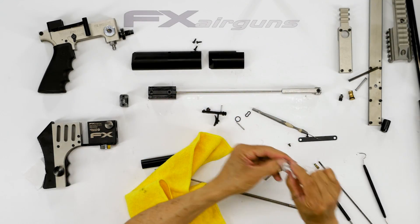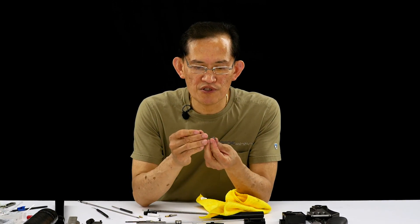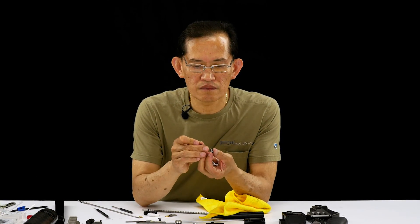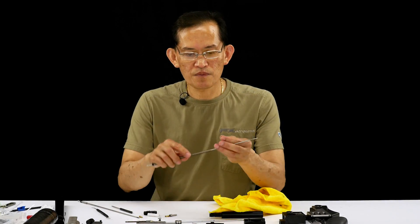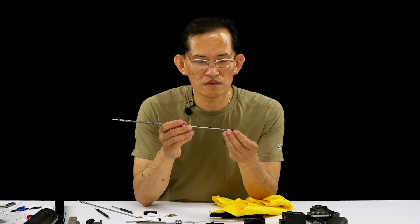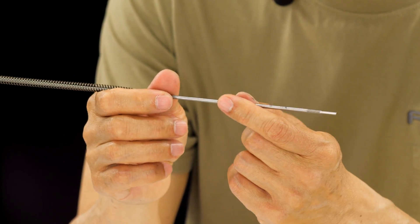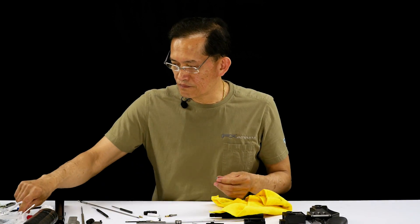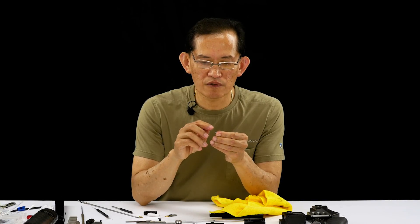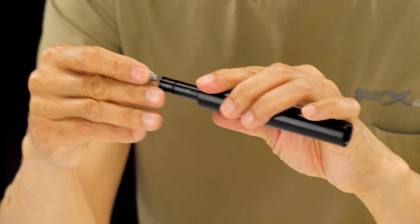Here also it is dirty. You have to inspect this piece — make sure there's no burr sticking out at each end, because this will gouge up your valve rod. Make sure it turns freely without binding. Lightly lube the end that makes contact with the quad ring or o-ring.